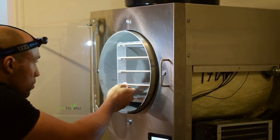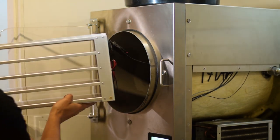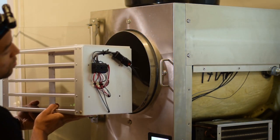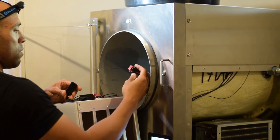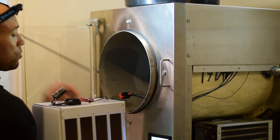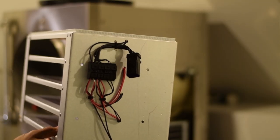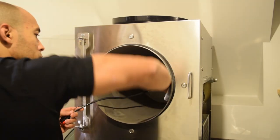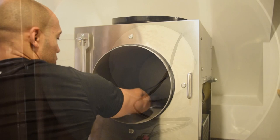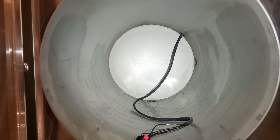You can see here the heating element of this machine is in the trays. Within this vacuum chamber it's minus 40 degrees, but at the exact same time there's a very slow increase in temperature in each of these trays. The trays themselves are wired to give off small amounts of heat that slowly sublimate the moisture away from the food. That moisture usually turns into ice around the vacuum chamber. There's a defrost function on the machine which takes a couple hours afterwards and it's not very loud at all. It's the vacuum pump that can be quite loud.